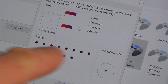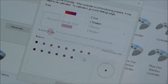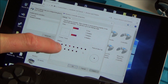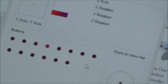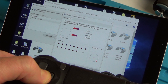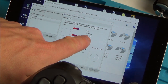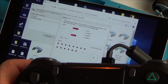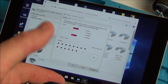Each of these will light up when we're hitting the relevant buttons. It's disconnected again because every time I wobble this it goes off. So if I hit this button here you will see it's lighting up as number one, that's number four, three, two. And this one here is for the D-pad — you can see it goes with the arrows when I move it round, and you can do diagonals. When it comes to the triggers, if you have a look at the X and Y rotation, that's what moves there. The left and right triggers appear to be working fine. All the other buttons appear to be fine too, because they're all lighting up.